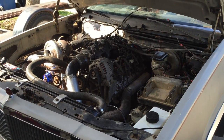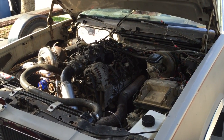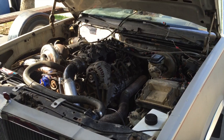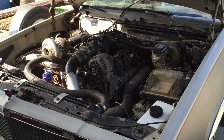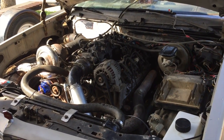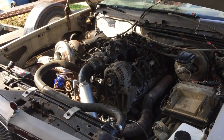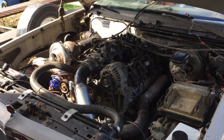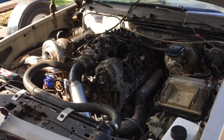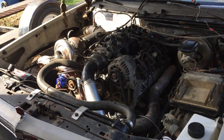So about 3 weeks ago, we started tuning this thing. My buddy Toma hadn't got his dyno set up, so I said, the hell with it, we'll street tune it. Started out with one of Matt's tunes that he has on the Sloppy Mechanics page now. We ended up putting the 70-pound injectors in. I ran with the stock injectors just decapped, and I pulled the plugs a couple times. Everything looked okay, and then I had one lock up on me, so I ended up borrowing a set from my buddy Justin, and then I'm just gonna throw another set back in this thing after. Did that.